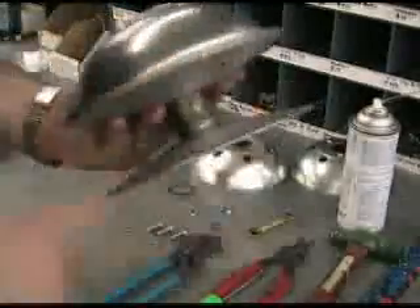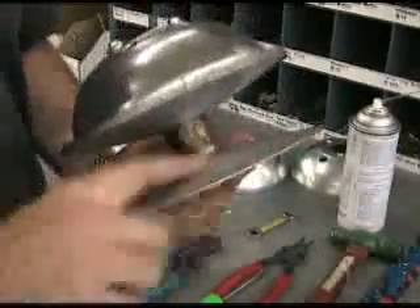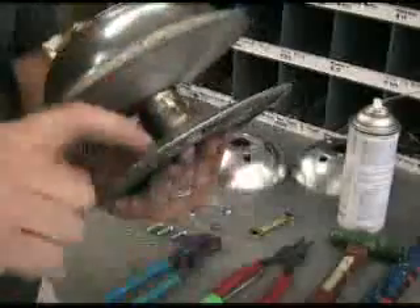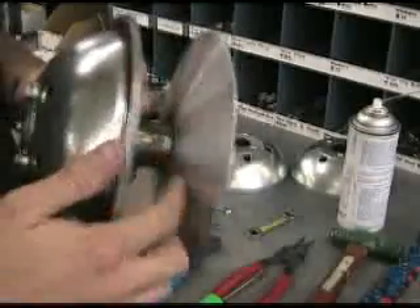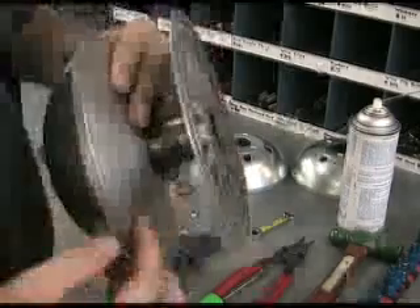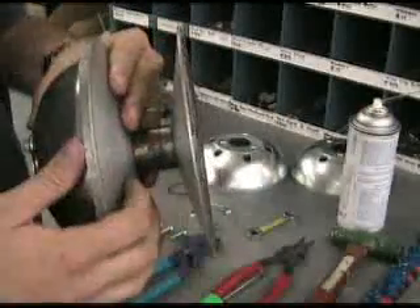What we have here is this is the base plate for the drive clutch. This drive clutch isn't replaceable — if you need to replace the base plate, it's time to replace the entire transmission. We generally don't just sell this item; they come as a complete unit. Some things to look for on an inspection are ramps and ridges inside of here that are caused by the belt wearing from certain positions being held on a highway. Like if you're a consistent 60 mile an hour rider, you would see a certain wear line in here.